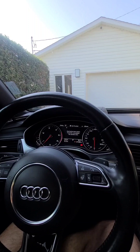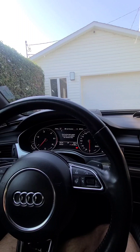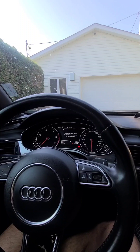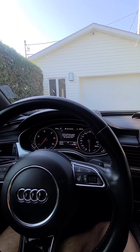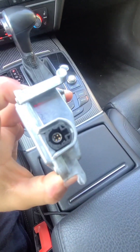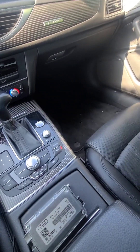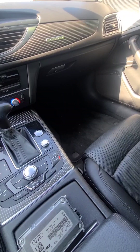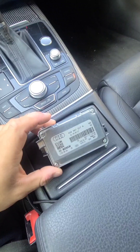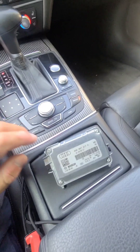You should be scanning your car first thing with VCDS, OBD-11, whatever. One of the codes you'll be getting is the C1107, which is going to be saying something along the lines of no signal for the imaging cable. The imaging cable is this cable over here that goes straight on the side of the camera — it's a four-pin cable, and it's the one that connects to the imaging module on the floor. I did a continuity test and the cable was totally fine. I'm making this video because getting all this fixed can get very expensive very quick, especially if you go to a dealer.